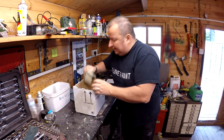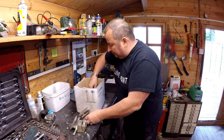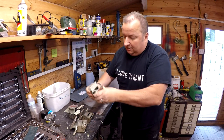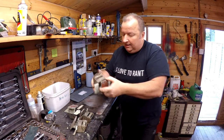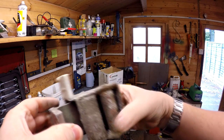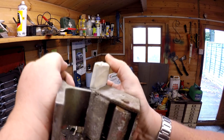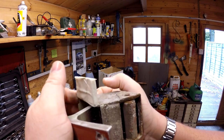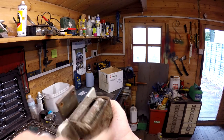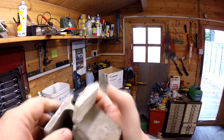I've got these hinge brackets here which I took off the car and these are going to need refurbishment because they're really, really stiff. As you can see, you can't really move them at all. Here's the hinges where they're actually tight — it will be in these pin areas here. Now I can force them open but some of these are really tight. I'm going to sandblast these but that will only get the outer rust off obviously, and I really need to get that pin lubricated inside.